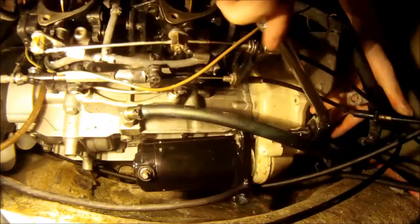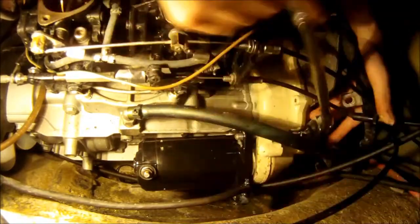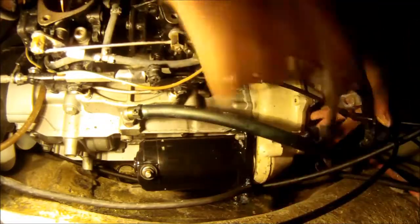An air ratchet or an electric ratchet would really help at this point. Just make sure if you're going to go that route that you are very gentle with it. You don't want to get this cocked or crooked as you tighten it down, so just make sure you go easy on the trigger if you're going to do that.